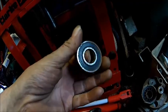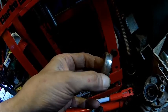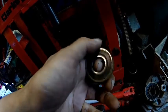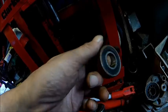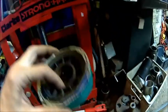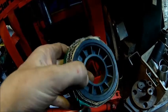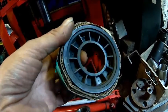It's been molded in, and I don't know if that's good for the bearing, because moldings get hot, so the grease may come out, but it feels like there is some loose stuff on it. Don't know. Maybe it's ultrasonic welded. You know, if they mold it with a bit of overshoot here, and then you just use an ultrasonic welder and push it down to make basically that recess here.